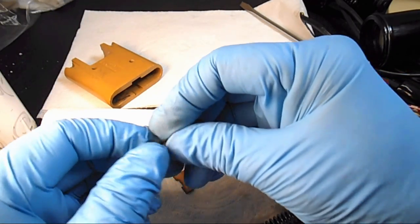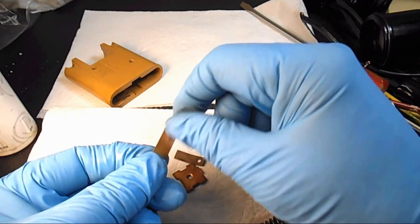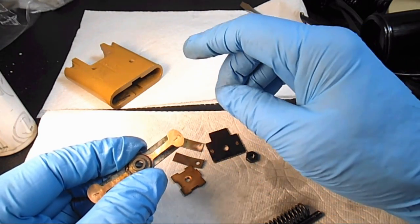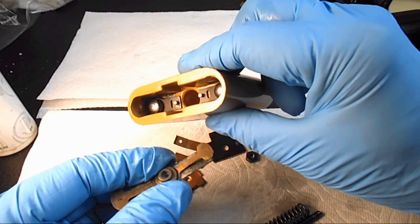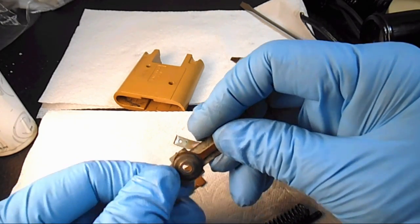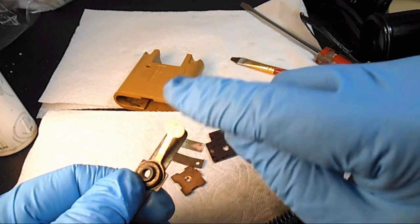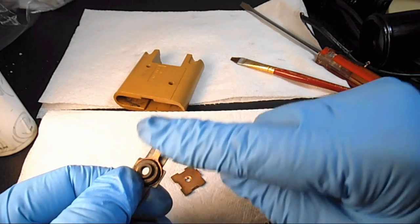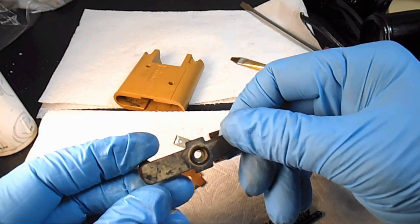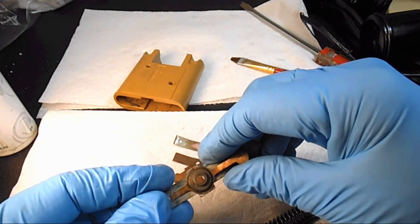I've done it many times with a Q-tip, cotton bud, and some metal polish to clean the contacts up. These do contact the carbon caps, so that's why they usually will have carbon deposits and they can be pitted. I've seen some pitted so bad that I had to polish them up and put some drops of solder on there, let it harden, and then come back and grind it smooth because they almost had holes in them — but that's pretty rare.